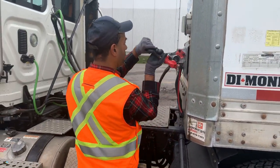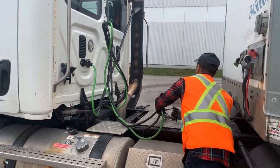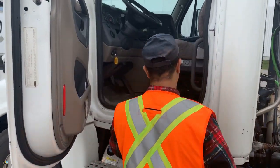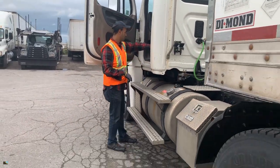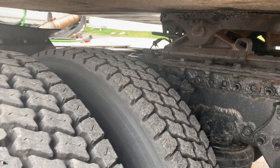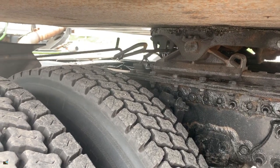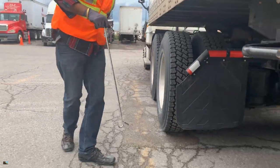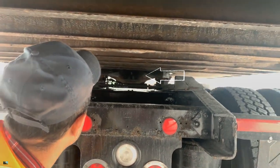Let's take the airlines out first — your supply line and your service line. Then grab your fifth wheel puller, stick it right in there, and pull it out. The fifth wheel handle is now in the unlocked position. To confirm it, go under the trailer to make sure the jaws are unlocked. The jaws are unlocked now.